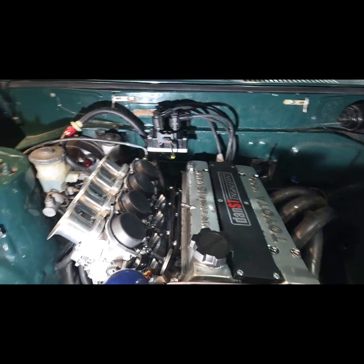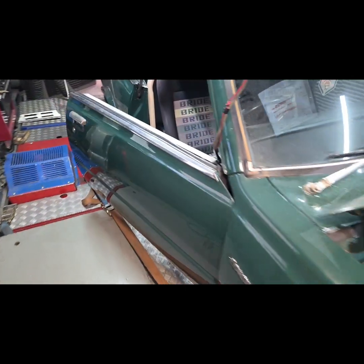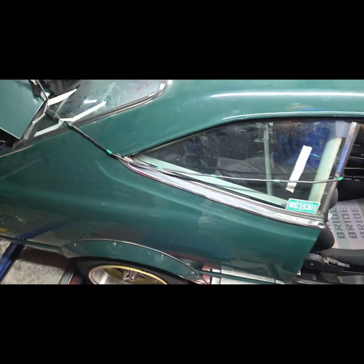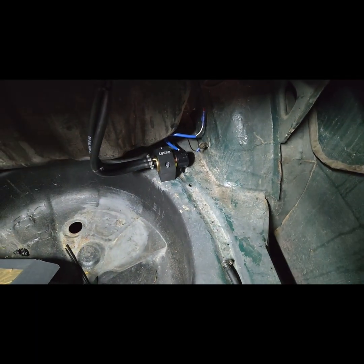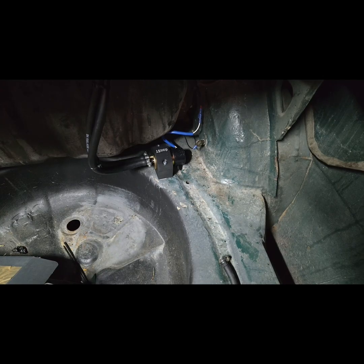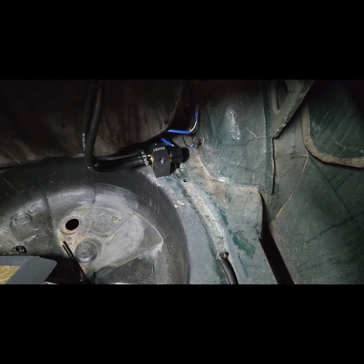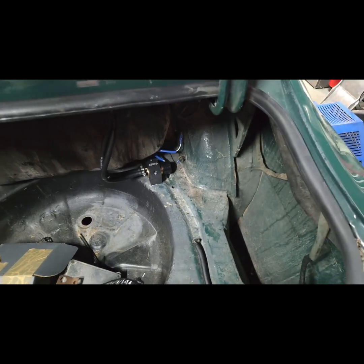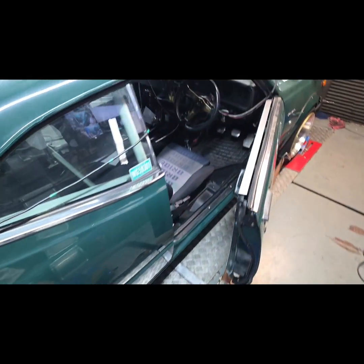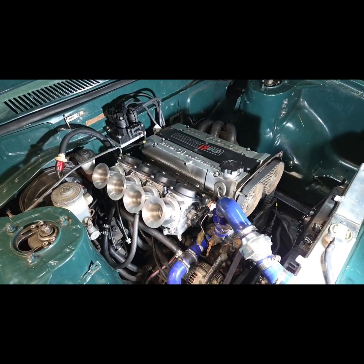That's basically our kit — nice and easy to install. On this one we have actually fitted a bike pump in the back as well. Coming round to the back of the car — check out those 70s lines on the way around. I really like the styling of this car, I think it's really cool, really unusual. So in the boot we've got our little bike pump with our 3D printed saddle for it as well, nice and simple. That's a low pressure interrupter pump so it doesn't need a return line, which makes it nice and simple. It's just a feed into the pump and a feed out up to the carbs. When it gets up to pressure it'll stop clicking until the carbs need more fuel, at which point it will kick in again. So that's the install — that's the ZX6 37mm carb kit that we offer. We also do offer a 40mm carb kit, slightly more expensive, but if you've got a really highly tuned engine then we can do you the 40mm kit as well.